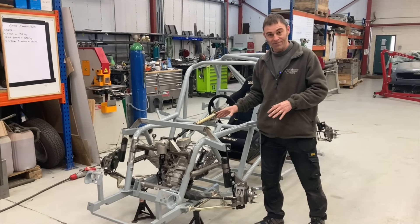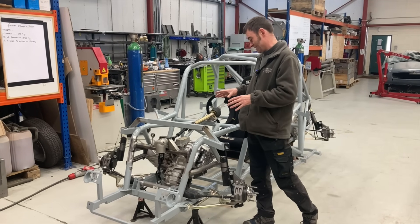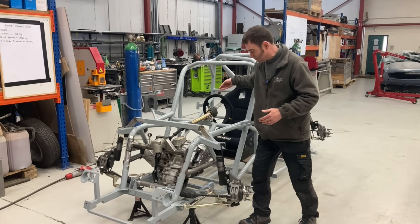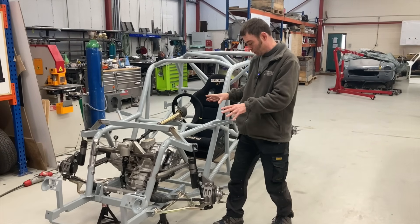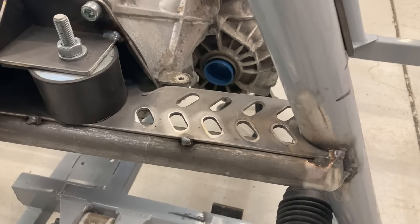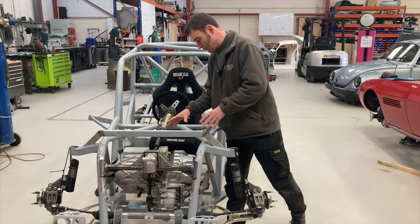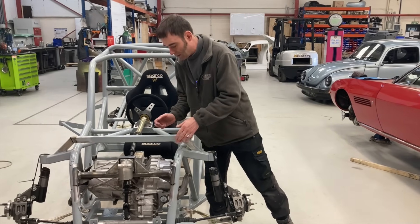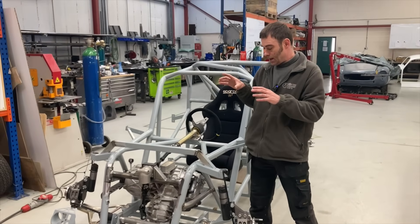So what's happened so far? We've got the motors in — that's the first thing to say — and we've sorted out the steering conundrum I left you with last time. Obviously with a motor in, you couldn't get the steering column to where it needed to be, so we had to go around a 90-degree bend. Let's cover the motors first. The front Tesla motor is mostly in and tacked in place — it's definitely in the right place. The drive shafts are coming out in the right place and it's as far forward as it can go without hitting the steering rack.